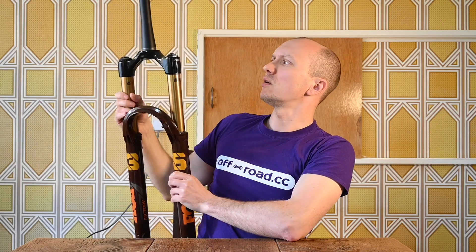You'll also notice the crown has changed shape quite a bit — it's now canted much further forwards. That's to give better clearance with the latest generation of bikes, which tend to have much fatter head tubes. With forks now having shorter offsets, the crown-to-head-tube gap was shrinking, and with a really fat head tube you'd risk that hitting your head tube, which would be a very bad scene. Fox hasn't made big stiffness claims but they have beefed up the crown, which also makes it look better alongside the big fat head tubes on modern bikes.